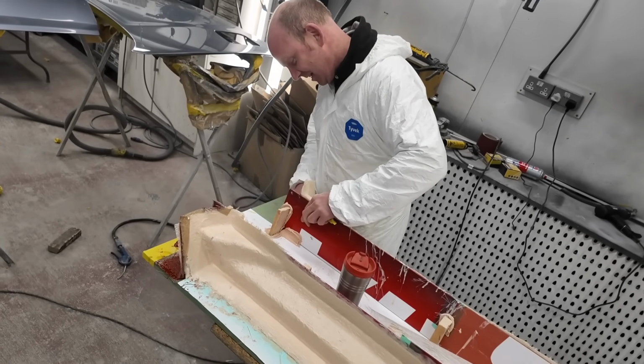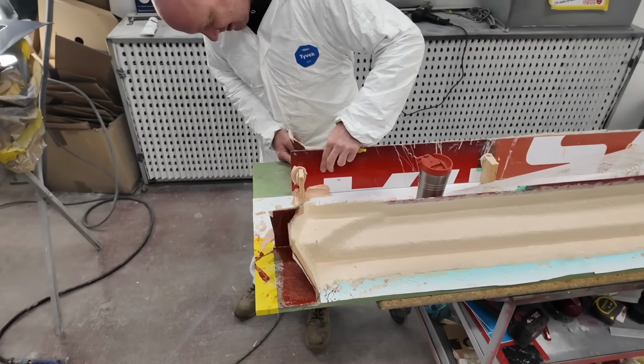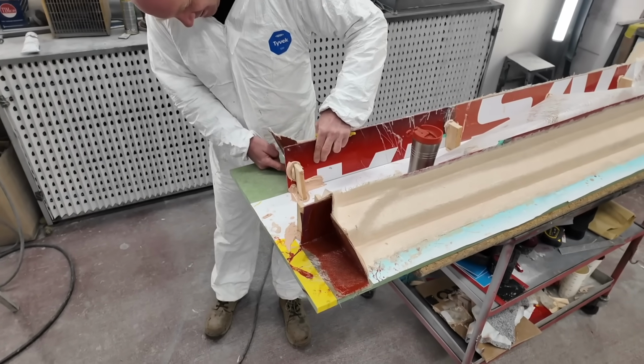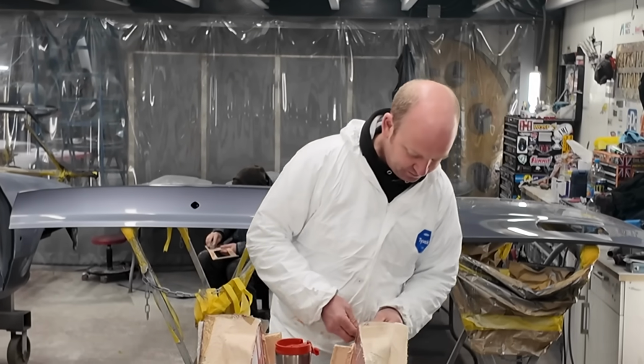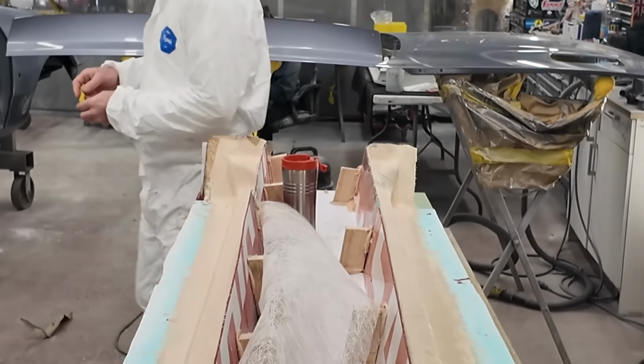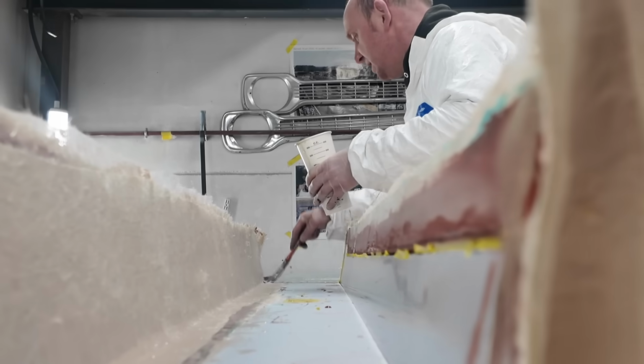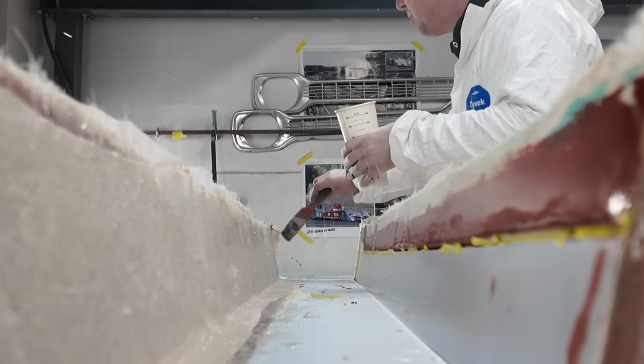So here we are making the moulds in fiberglass using a tooling resin. It's a Scott Bader product, Optimold, bought from East Coast Fiberglass Supplies, and it's a vinyl ester resin system, so that you can make carbon fibre parts in it should you want to.